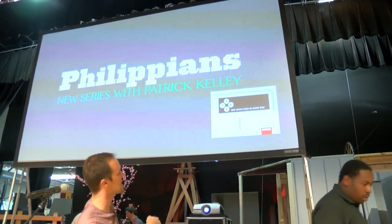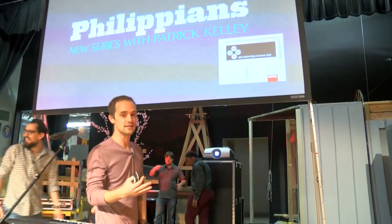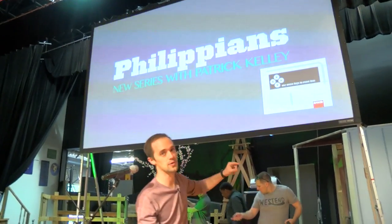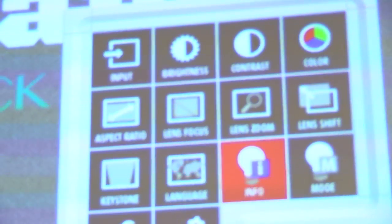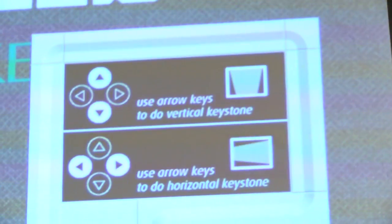and you'll go to lens shift. Lens shift moves the image, doesn't make it bigger or smaller. Use the arrows again to shift the image down, up, left, and right. The key to making sure your image looks good is to really pay attention to the 4 corners. You want to make sure there's no gap in those 4 corners. If the image looks weird, like it's not flat against the screen, use the keystone option to keystone it and to also adjust the vertical keystone.